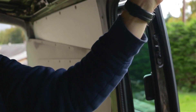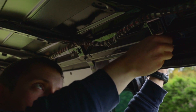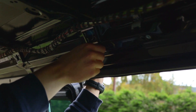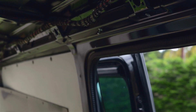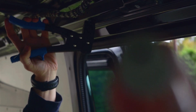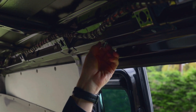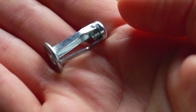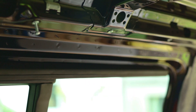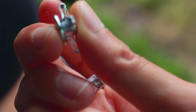Yesterday we took down the roof panels, so now we've got the roof exposed and we can run the wiring through and put some insulation in before we put it back up. What Craig's doing right now is fitting some things called jack nuts — these metal things. We're going to use them instead of the horrible plastic clips we used when we put the wall panels up. The plastic clips were really rubbish because the head just burred when you put the screwdriver in, and we also found that some of them have popped back out on the wall panels. So we've decided to replace all the plastic clips with jack nuts and metal bolts. This is what a jack nut looks like to start with — you put a bolt in, use a special tool to compress it down, and it holds the nut firmly in the wall. It should be way better than the plastic clips.